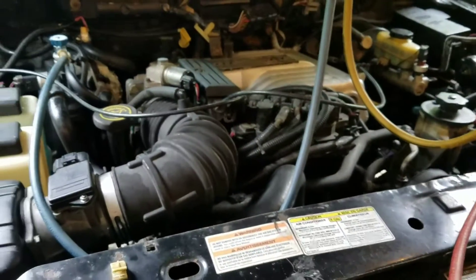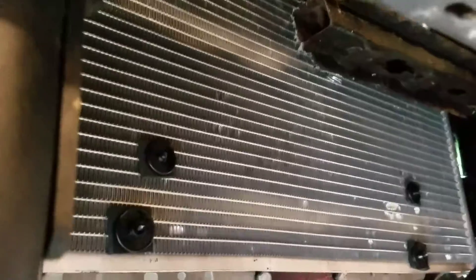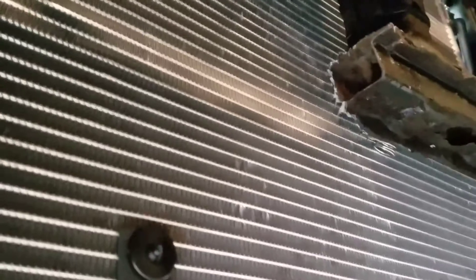What I thought was the reason — I'll try to show you here — this is the AC condenser. It mounts to the front of the radiator and goes up the front here. Before I started working on this, I had an issue. This is a cross support that goes across the front — it's rusted pretty bad under here. The jagged edges on the rust had collapsed into the AC condenser. I live in a pretty rural area with bumpy roads, and it basically rubbed a little hole in one of the tubes on the condenser, causing a Freon leak.